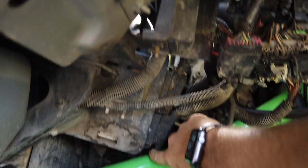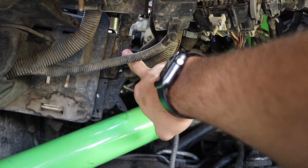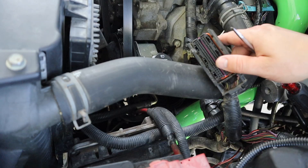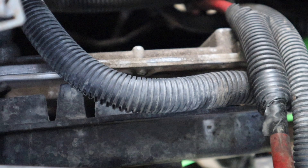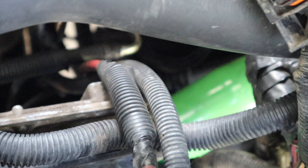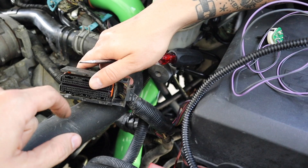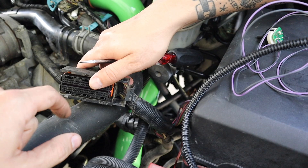Since we got our pilot holes drilled and we know where our switch is going, the next thing you want to do is pull this clip up and this clip up also, then remove these two out. Then I'll show you what pins you want to insert your DSP-5 connectors into. The computer is held in with these two tabs. Corey held the tabs out, which allowed us to get the computer free — we were running into an issue where the hot side intercooler piping wasn't allowing us to release the first clip. Now we have the two connectors out of the computer. Next, we're going to pop this plastic casing off and locate pin 46 and pin 54.